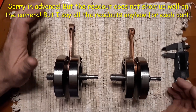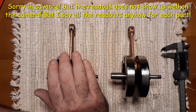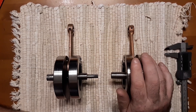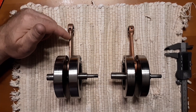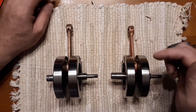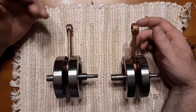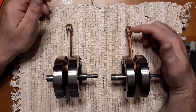Alright guys, we're going to talk about basic crank design and how these work. This is a 38 millimeter crank and this is a 40 millimeter crank. I'll show you how to find that really easy. You'll find these in 50cc and 80cc builds - things like the LD100, BT100, YD100, and Phantoms. This is a long connecting rod and this is a short one. You'll find the long ones like an AF80 on this crank, the same length as the YD100 rod, and those are in the 80cc builds. The short ones are usually for cylinders that have no head, like the Flying Horse builds and 50cc builds.